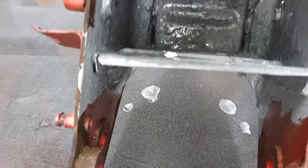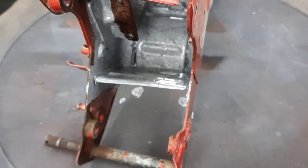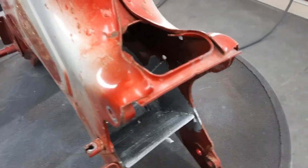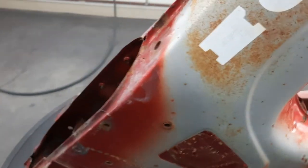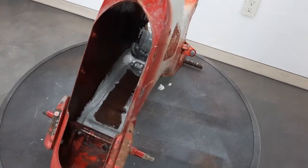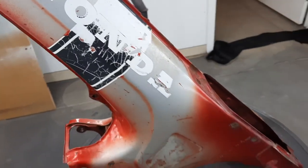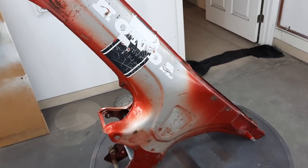Look at that splooge underneath here. When I'm done with that and it's dry - it dries to a rock hard shiny cover, almost primer color - I'll just fog in primer. The other surface rust will be taken care of with the spray stuff, and when that turns black I'll hit it again. It's a little precautionary process. I could have painted it and it would have been years before you'd have seen anything - it's not even bubbling on the old paint. Now we'll let that cure up, get the emblems off, get it sanded down and flat for its first coat of primer.